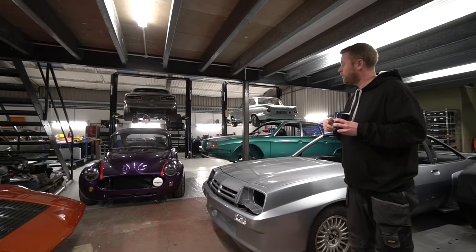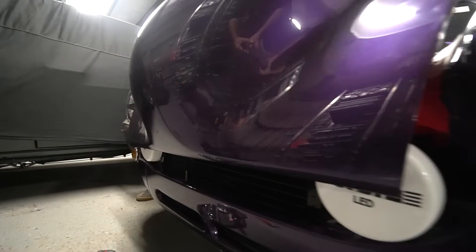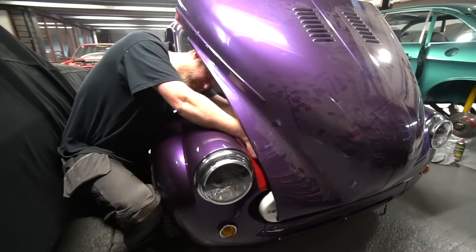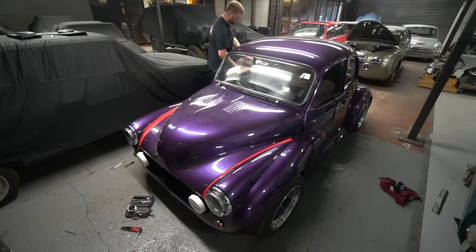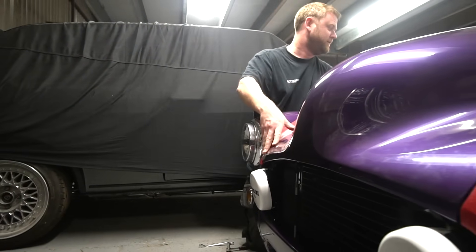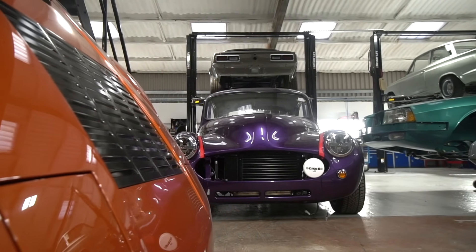Maurice is looking very cool with his bonnet on. Getting it adjusted was a bit of a pain because with the gas struts on, it changes the adjustment slightly versus without them, and the gas struts try to force it the opposite way to how you're trying to move it. The easiest way is to take the gas struts off, shut it, then do the bolts up with it in the right place - though it's quite difficult to reach the hinge bolts from the front with the bonnet shut.